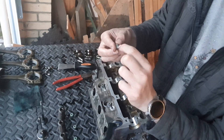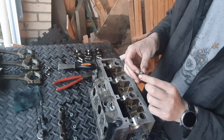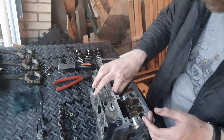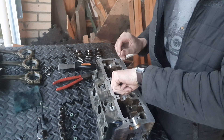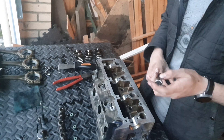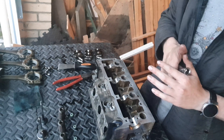Next up, we're going to refit some new valve stem seals. They're just a metal ring that holds it nice and solid, with a rubber coating inside which grips onto the guides and surrounds the valve stem to create a blockage for oil coming through. Fitting them is the easiest part — you just fit them over the guide and push them on. They seat fairly well, but I'll use a tool to give it a whack to fully seat it down onto the guide.